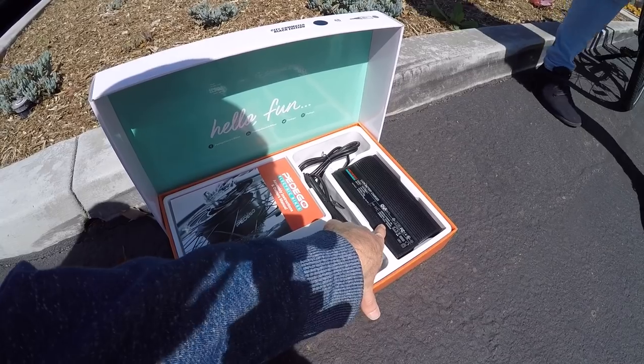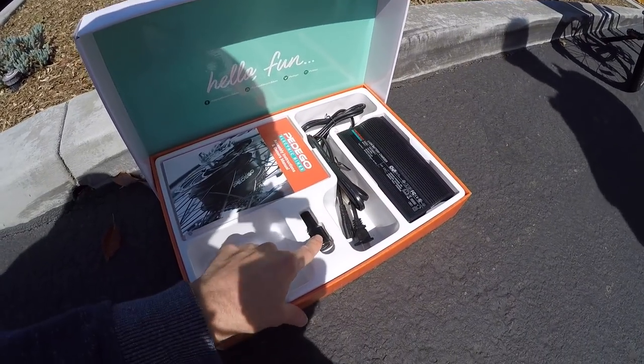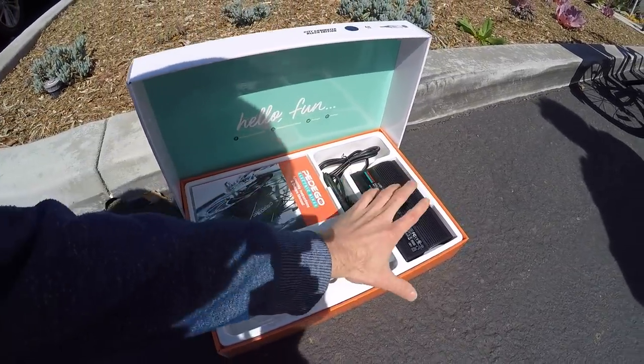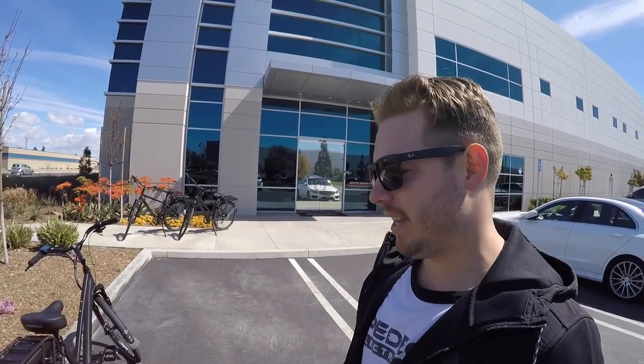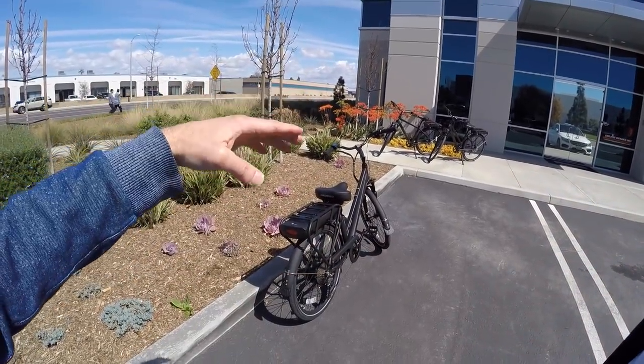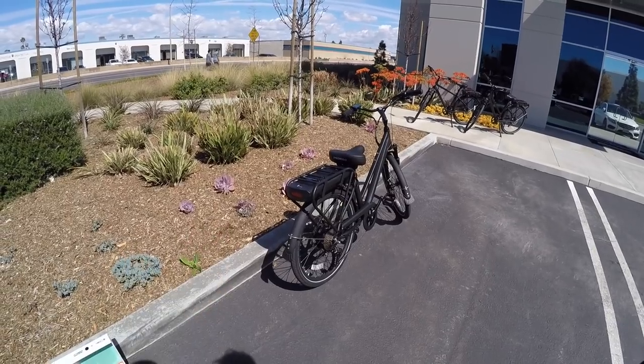For the 15 amp-hour battery, it's nice to have a faster charger — the 15 amp-hour takes about five hours and the 10 amp-hour about three and a half hours. The first half of the battery charges much faster since the cells don't need to balance yet — charging is slower and more careful toward the end. These use Panasonic cells, which are among the nicer batteries in the industry.